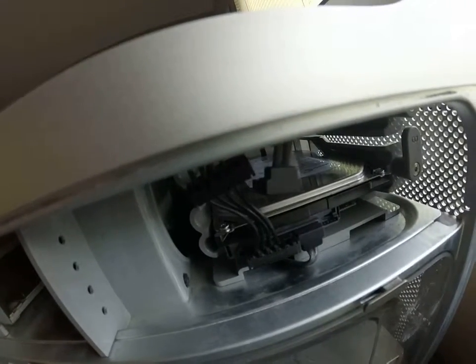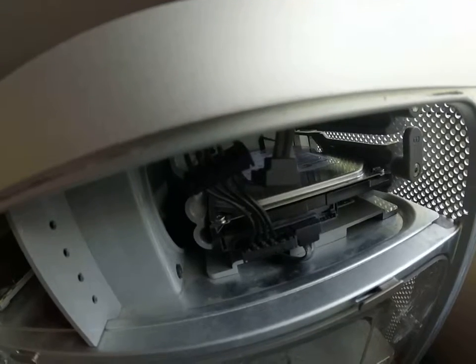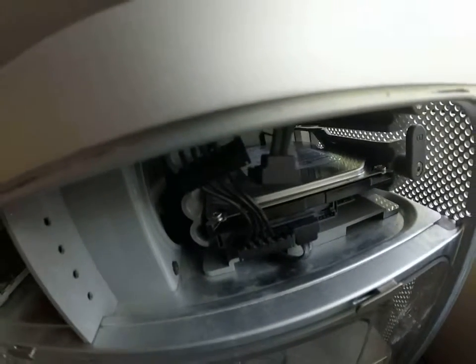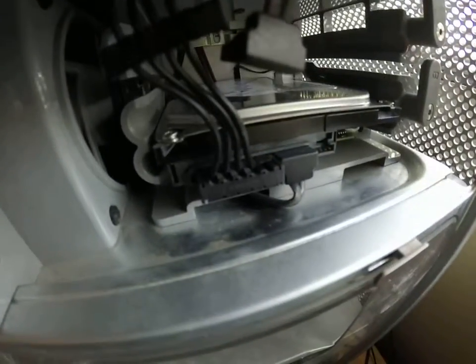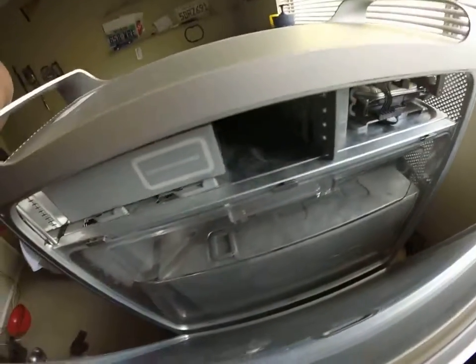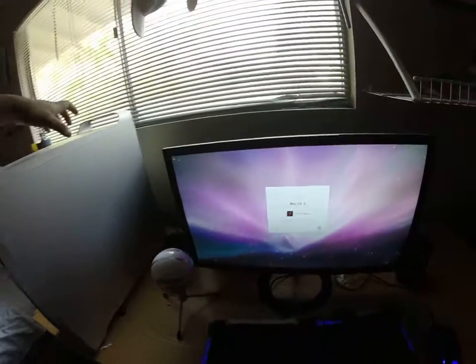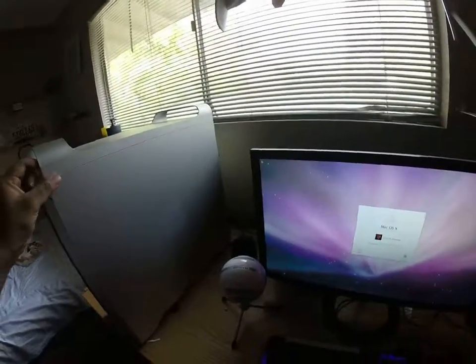I'm not too sure what caused it, but I do know the iMac I had had the same problem — but it only had one hard drive slot so I wasn't able to get that going. I think it might be the cables themselves. You can actually hear the hard drive spinning and everything is working properly. Hopefully this helped you figure out why your Mac won't boot up properly. I would definitely recommend swapping the hard drive placement before you do anything else.